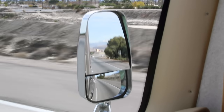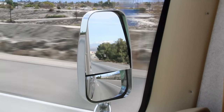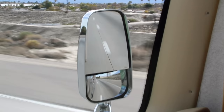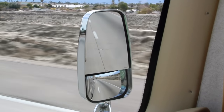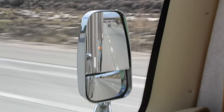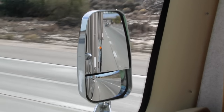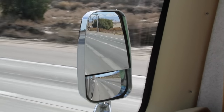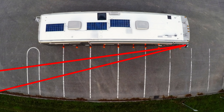If we adjust it too high, we're wasting valuable mirror area looking at too much sky. If we adjust it too low, we can't use the mirror for its primary purpose of seeing vehicles in the distance. Adjusting it too far in will again waste valuable mirror real estate watching the side of the RV, and too far out will open up a blind area alongside our rig — if we can't actually see the side of the RV, it could allow vehicles to approach us unseen.